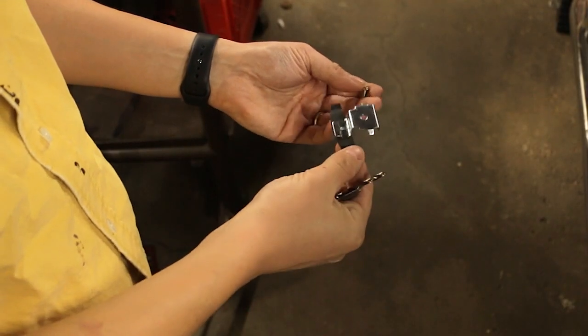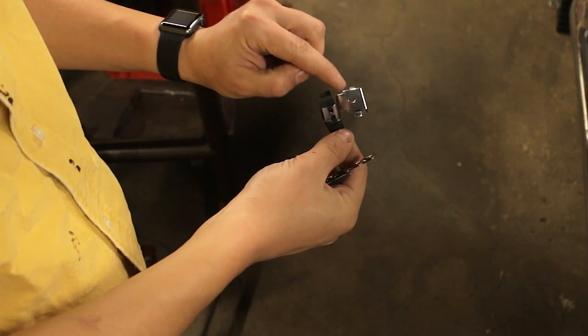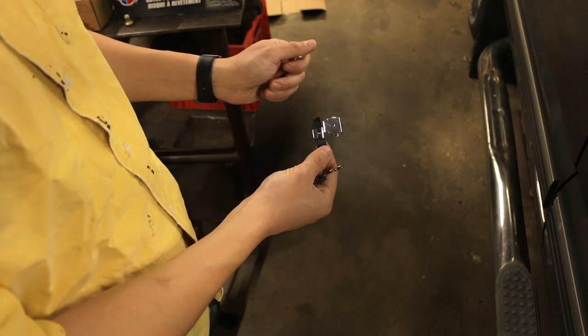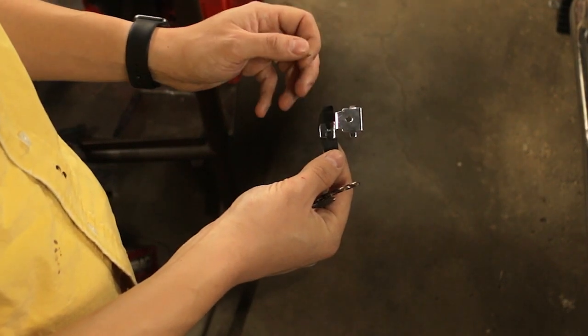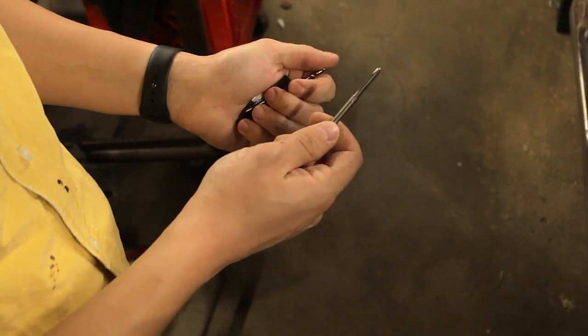To recap, we can't use the hole on this bracket anymore because there's a busted off screw extractor on the cast iron piece that's on the truck. And you might think, oh, just drill it out. Generally, drill bits aren't made to drill that stuff out. It's hard enough to drill that out that it's actually easier to just drill a hole off to the side, and it'll come back with this tap.